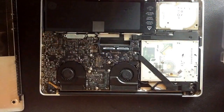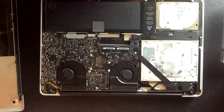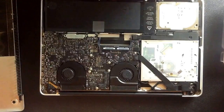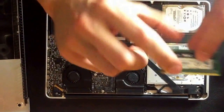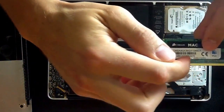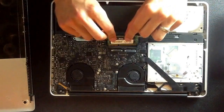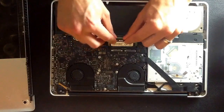I'm going to pop this one out too. What's happening is my computer is doing three beeps when starting — those three beeps let you know that you need to reseat your RAM. I upgraded my RAM and after I did that I ended up having some issues, so this is how I figured that out. I'm just going to take this and put it back in the same way. It's got a little chip or slot right there, which lets you know you're putting it in the right way.